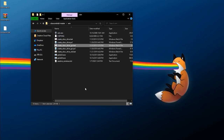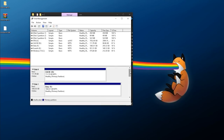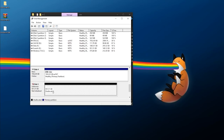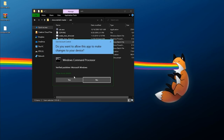Before we run the script, let's make sure we hook up our new drive to the PC. I've hooked up my solid state drive, and on Windows you want to look for Disk Management or 'Create and format hard disk partitions' to make sure it's setting up. You're probably going to get something asking you to initialize a disk — do not do any of this yet, just click Cancel. Once everything populates, you can scroll down. I can see my SSD listed as unknown and unallocated, so we don't want to touch anything yet. Keep Disk Management running.